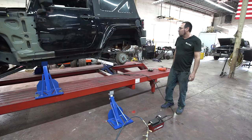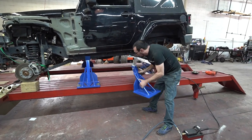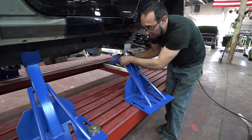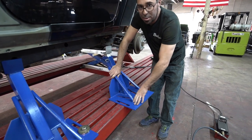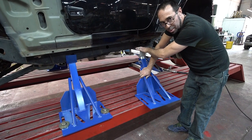Now that we've got the rear of the vehicle up and the tires off, the same way we set up the front, we're going to put the rear in the other truck saddle. These are adjustable, but for this situation we're going to run them at the exact same height. All four truck saddles are made in a jig so they're all identical, so if the vehicle is sitting in these you can take exact measurements and know whether you're still bent or crooked.